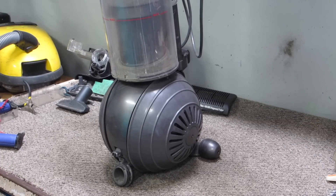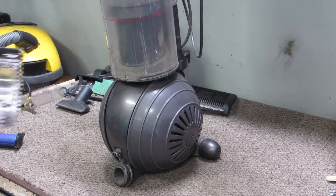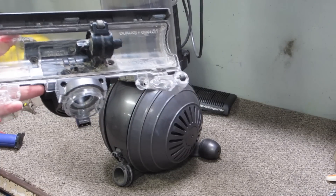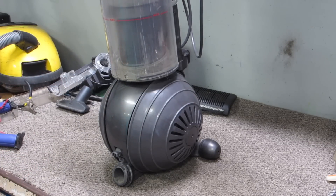This is going to be very different from what has been seen before. This is a Dyson Big Ball Cinetic, and it was traded in here because the owners had a pretty large Labrador and hair was completely clogging the nozzle basically every time they used it. They brought it in, I diagnosed it, and there really wasn't anything particularly wrong with the machine itself other than the pretty narrow air path, which is normally sectioned off by a divider in the nozzle.